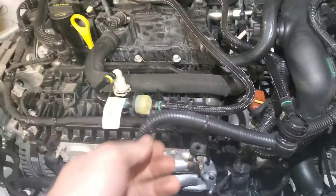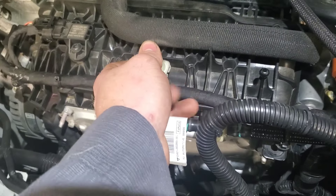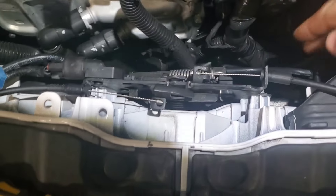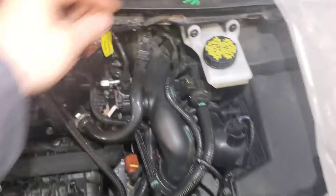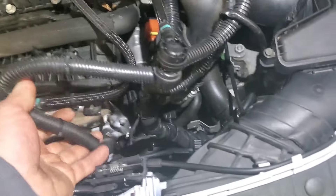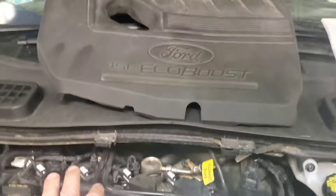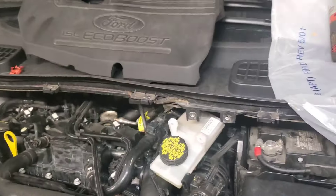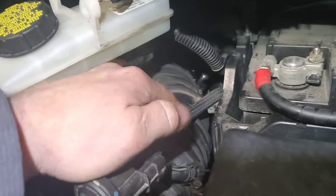I used my trim tool and pulled this top port off — it goes right here. Push the quick connect in, pull up. Then I fished my hand this way and my other hand on the other side behind the wires, put my finger down and pulled the green tab off, then pushed the connector underneath which is right here. Pull that off and now I'm going to work this back — the connections go right there, that black and white one. I pulled two T25s off right here, moved it off to the side, and shoved my arm back in.